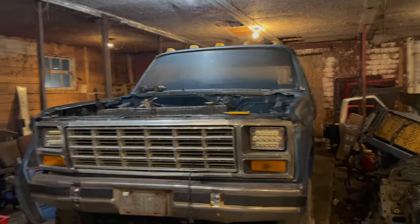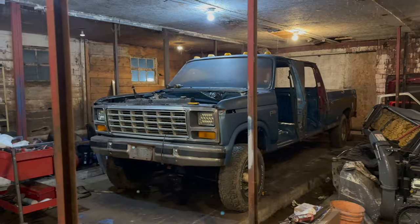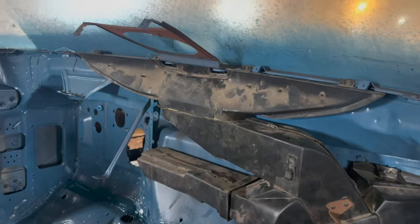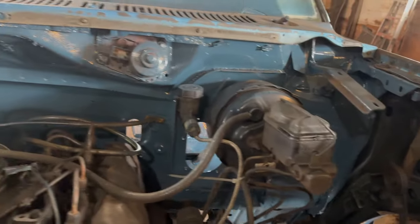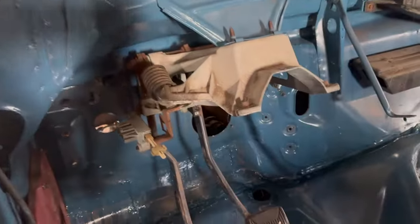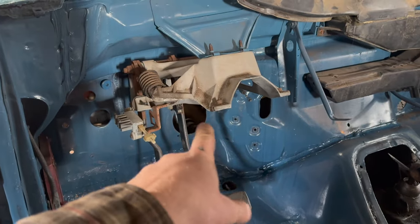Updated the grill to the 81/82 style — eliminates the Ford badge right on the front. I think that looks a lot better. Got the heater box all roughed in, got the shifter all back in. Now I've got to do the HVAC — got the inner heater box all put in. Got the brake booster, master cylinder, slave cylinder, brake pedal assembly all inside. Let's put the accelerator pedal in. We're going to hold off on the steering column because we've got to do brake work first. The brake line that was in there had three junctions in about eight feet of line — you're not supposed to have junctions in these lines.